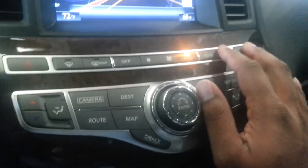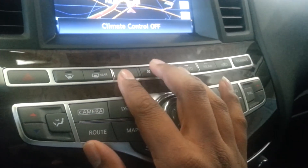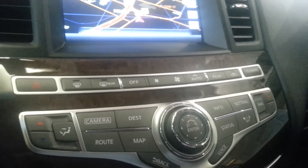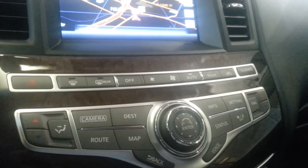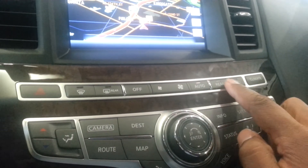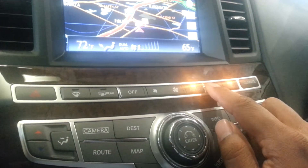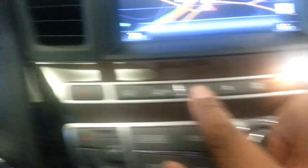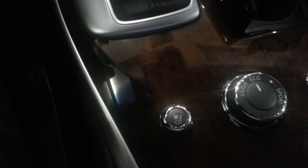In addition to that, if you turn off the air conditioning system and you hear any noise at all — any noise coming from any vent anywhere in the vehicle — it needs to be brought in for service. So again, if I turn off all my AC, including by pressing rear, bringing up the screen, and pressing off — now that is off — and also pressing off on the main, that's off. And my rear seat cooling system is off, meaning the compressor is off.